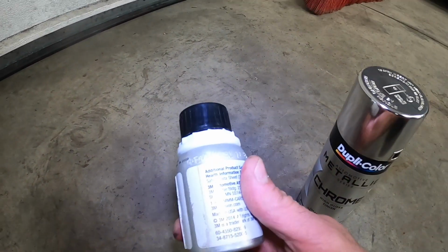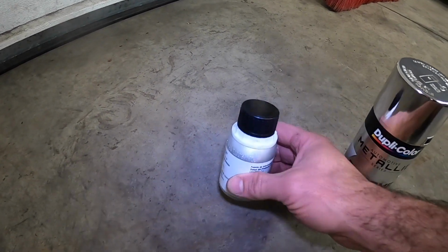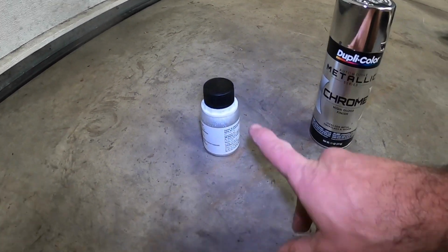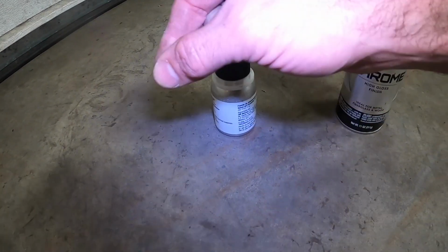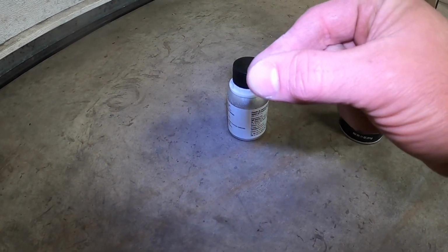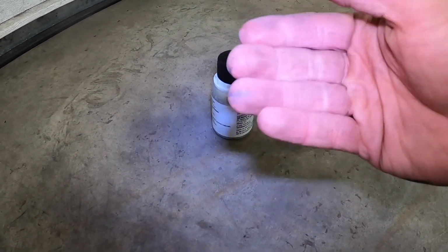And then the other thing is actually a primer. This is like a windshield 3M primer, linked down in the description. The reason that I'm highlighting this is because I wanna use Q-tips with this black primer around the outside perimeter of the taillight, and that's what I want to be the adhering surface that the Permatex clear adhesive actually sticks to.